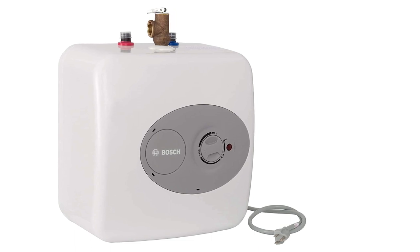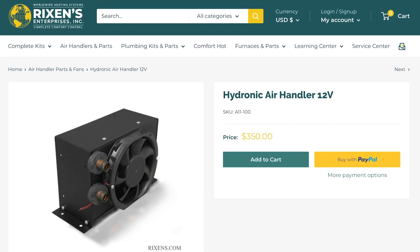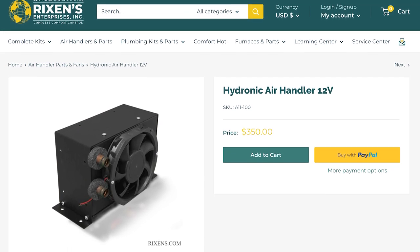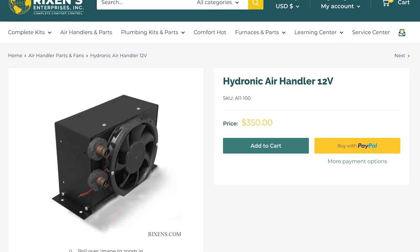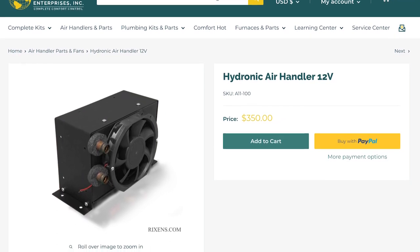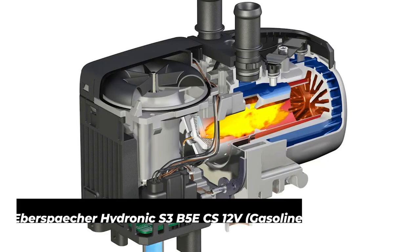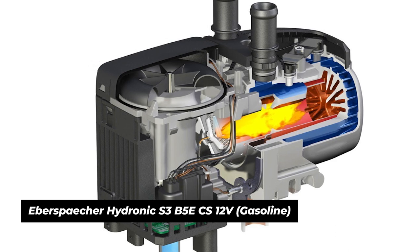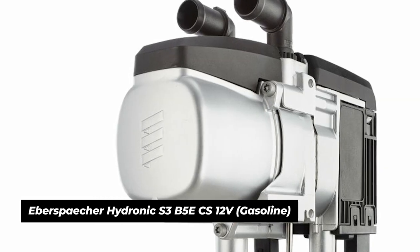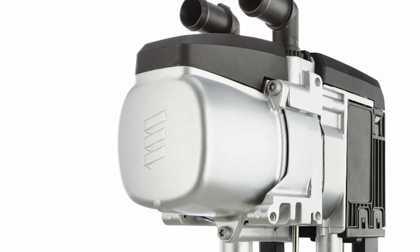You can also use that fluid to run through a radiator and then drive air through a superheated radiator, and you can also get your hot air that is pushed through the van. So you can kind of do three jobs with one system very efficiently as well, because the system is tapping in to your fuel system, whether you're using diesel or in this case gas, and you're just taking minute amounts of fuel to run through the furnace and actually heat up the liquid.